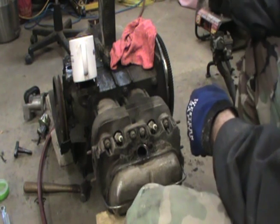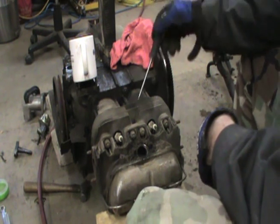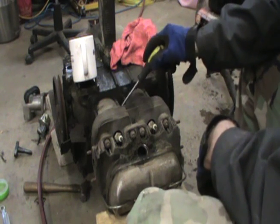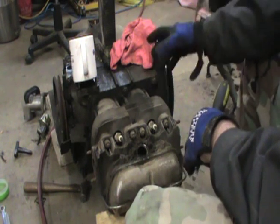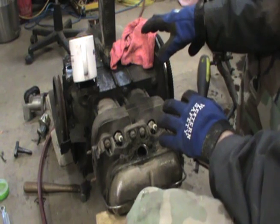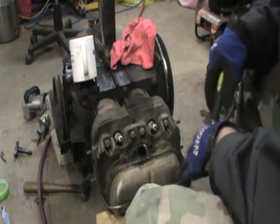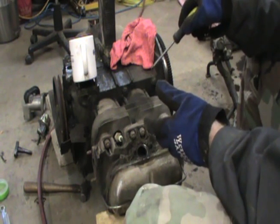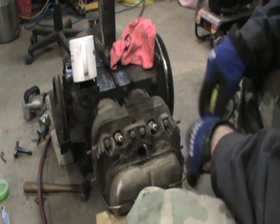All that came from drawing air through the intake on the doghouse and blowing it down on the cylinders. I've pulled Volkswagens out of barns when doing a project — pull it out of a barn and mice will build nests up in here. So if you're not familiar with your engine and it's been a while, if you're buying a project or whatever, check it out. You don't want to burn an engine up for no reason — it could have been a decent engine when it was parked, but after it sits a year, two years, seven years in a barn, mice will crawl up and build nests up under those cooling tins. Just a tip.